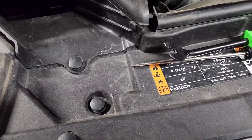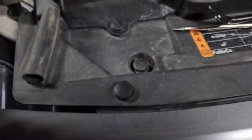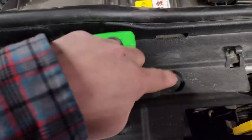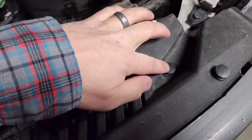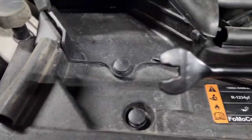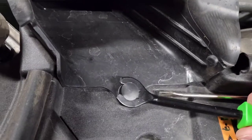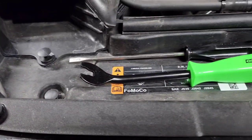First, you're going to remove — one, two, three, four, five, six, seven — looks like eight, nine, unless I'm missing one. Use a flathead screwdriver for the ones down here, it's just easier to get to. I also recommend one of these trim tools right here — you just scoop the bottom and it pops right out just like that.